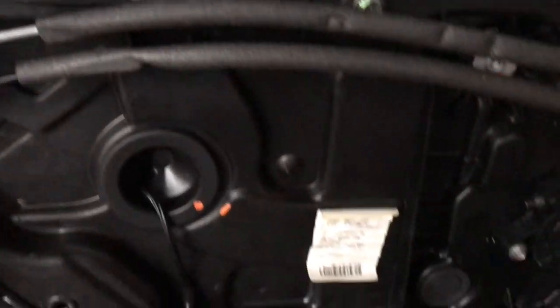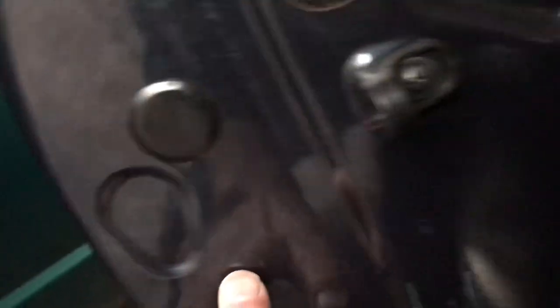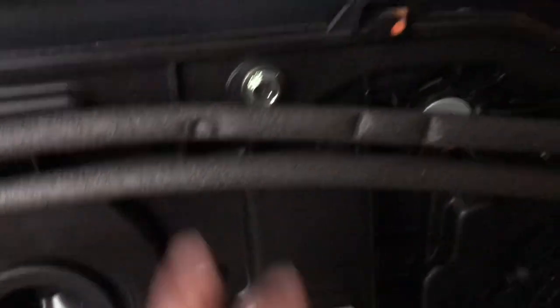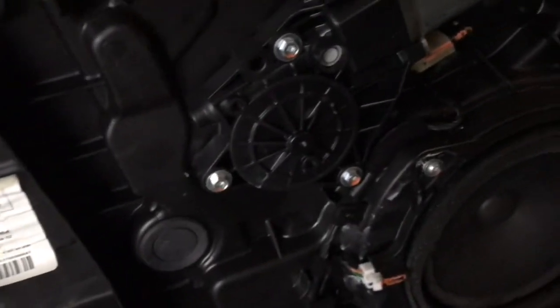I think I may have broken a couple getting them out — that's kind of the way it goes, especially since it's cold. Plastic is a little more flexible when it's warm. So there's a lot of wiring going on, a lot of stuff. I'm guessing I'm going to have to remove this latch. I think the latch is all part of the door actuator — the latch is here and the door actuator is all one thing. This inner skin has to come out. I think the window channel is part of this inner skin. There's some things to figure out.